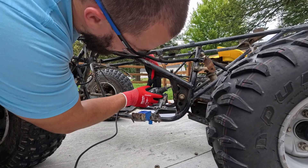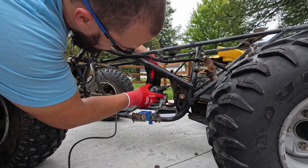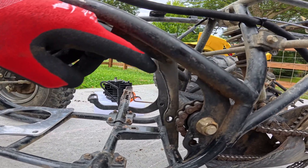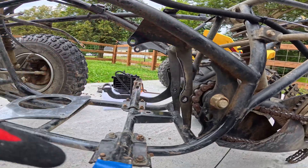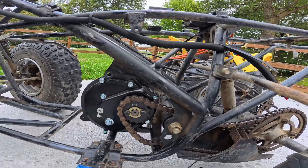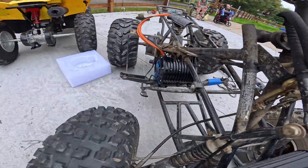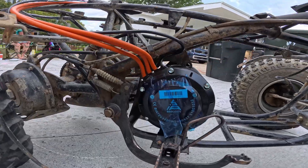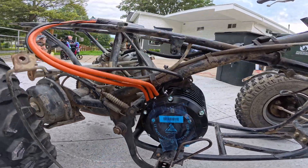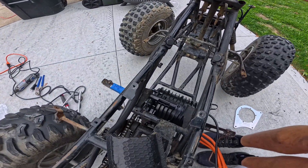Then I cut the main bracket on the left side. The reason being is the motor itself is round, so it has to fit in there. You can see here kind of how far into it we went — cut a little bit of a divot so that the circle can fit inside. And then BAM, we have the motor mounted! It fits nicely. I do have to adjust quite a bit here, but this gives us a rough idea for templating and how it needs to fit up in there. The bottom does hit the frame, so I will have to raise that a little bit, but for a rough draft I'm really happy with this. It fits nice and straight in line with the frame.